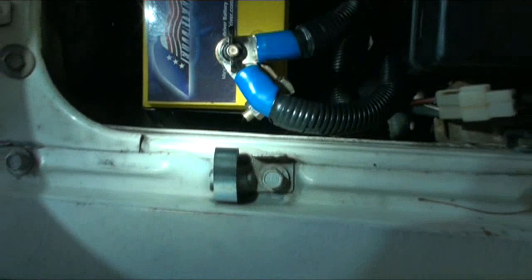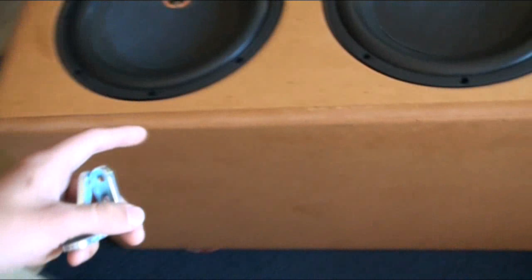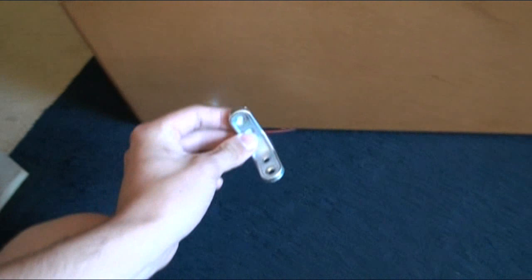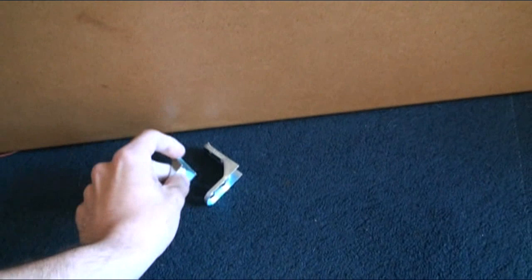Just before putting it in the car, I've got to think of a way of mounting the box. I was going to put some brackets on the back — obviously the box is going to be sitting down normal — and attach those and whack them into the floor. But that's not going to work because the floor under the car in the wagon is steel underneath. The front part of the boot would be okay, but the back part is steel where the box is actually sitting. And I don't really want to screw down because right under that is the fuel tank.